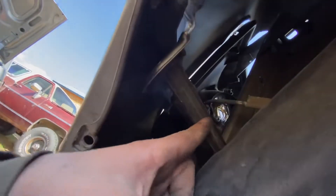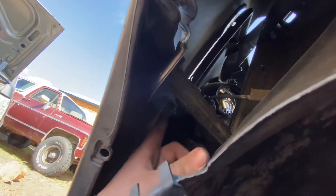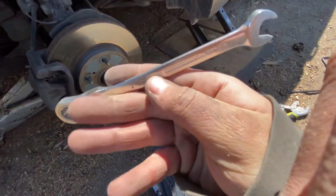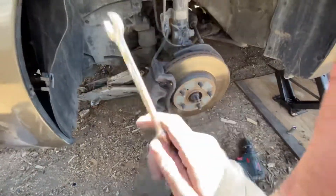After that, undo the sheathing so you can take this off, and then there's this little plastic piece right here — be extremely careful with it because it breaks easily. After you do that, you have to go behind here where the support is, and there's a bolt right there plus another bolt on another support right here. You need a 10 millimeter — I found the easiest method is to take a spanner and just wrench those bolts off, because I couldn't get my small ratchet back there.